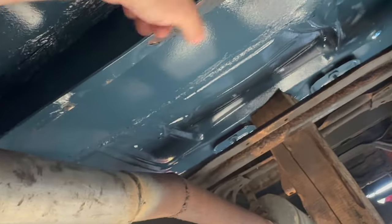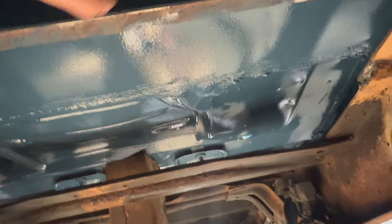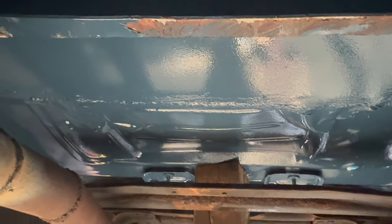This right here is the beam I got trimmed down. When it's down, it's sitting on my frame rails, and that's no good. I got to trim this guy down — thinking if I trim him down to an inch, it should work out for my body mounts on the back. It shouldn't really affect too much.